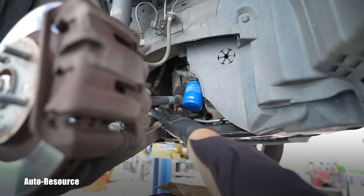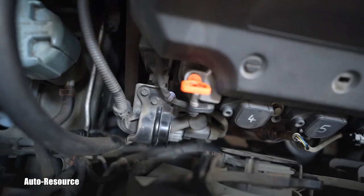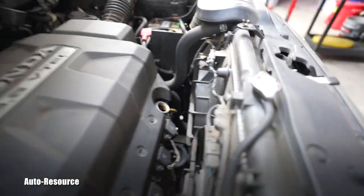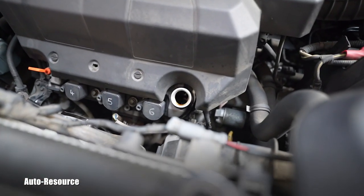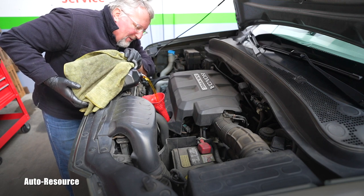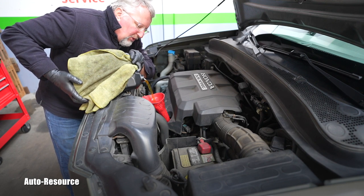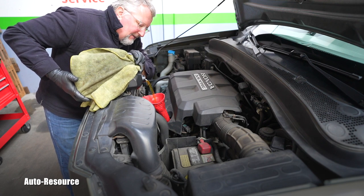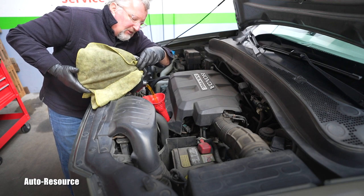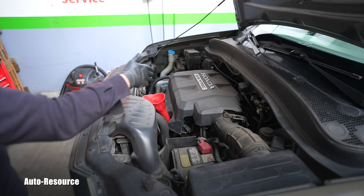I can remove the paper and skip all the messy cleanup underneath. Back in the engine bay, I push back the engine oil dipstick and remove the oil filler cap. This area is a bit hard to pour into, so I like to use a funnel — a huge help. I'm now safely pouring 4.5 quarts of 5W-20 full synthetic engine oil. Just a detail: this engine was designed for 5,000 mile intervals, but because of the high mileage I do oil changes at 3,000 miles.